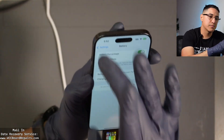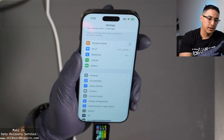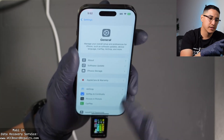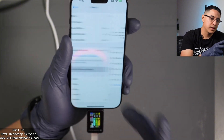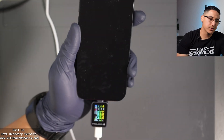This is why it's important to pair the parts. The rear camera works fine, the battery and everything works fine, except there are some weird limitations. To start, go to General > About > Parts Service History and click 'Restart and Finish.' If you get an error, you just have to keep trying it multiple times.